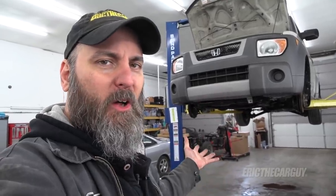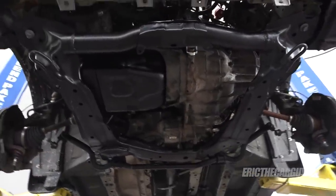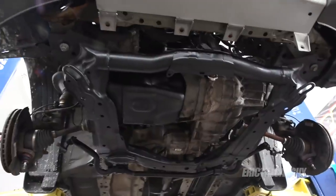Welcome back viewers — I am almost there, not quite. I got the subframe in, the engine's in, the transmission's in, and I got some oil in the engine. I took the valve cover off — the old valve cover — and before I put the new one on, I drizzled a bunch of new oil all over the camshafts and the timing chain and everything to try to make sure that the oil got down in there. But I got tired and hungry, so I went home and I'm back here today. I don't have a whole lot to do. Check out that subframe — it looks good. I think that was really worth it with all that effort.